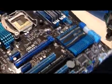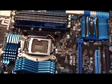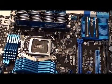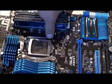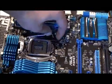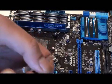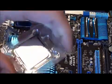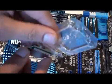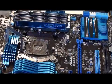Here's the motherboard — I've done a review of this motherboard so feel free to check it out. Opening the socket is the same as usual, like the socket 775 — you just clip it up and it opens. Just to let you guys know, if you're using socket 1156, the fan for the 1156 will fit the 1155.